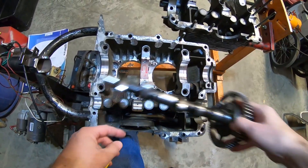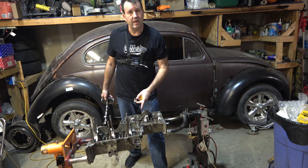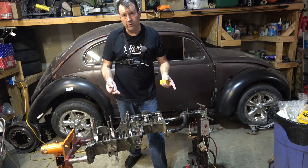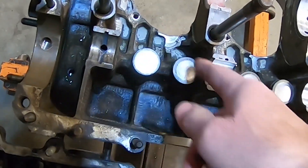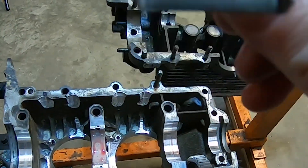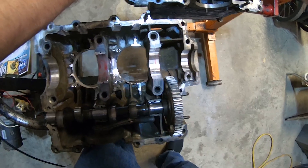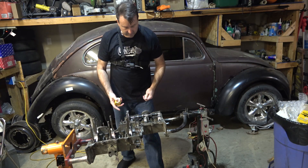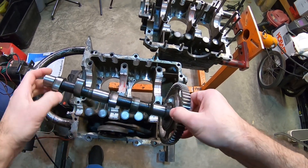The factory had three bearings where one looked like this and the others didn't have thrust. Now, Volkswagen only put a tang on one half of the case, and I'm very surprised that this bearing doesn't have a tang on it - most dual thrust cam bearings I buy have a tang on both. As you can see in this case half, there's no spot for the tang, so you have two options: you can either file a tang groove in the case, or file the tang off the bearing. Generally that's what I normally do - it's pretty soft material and comes off pretty easy.